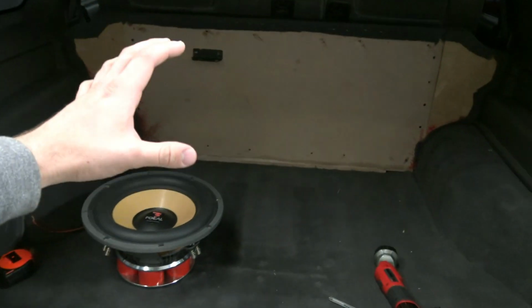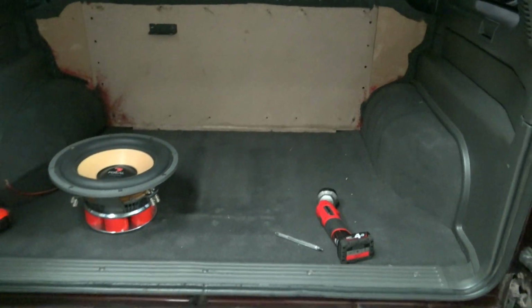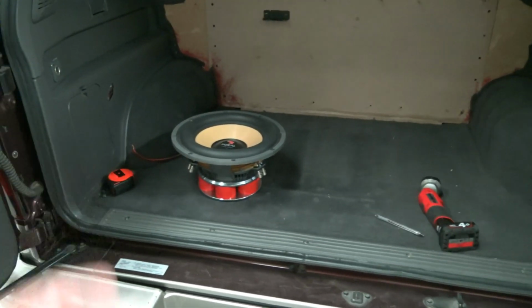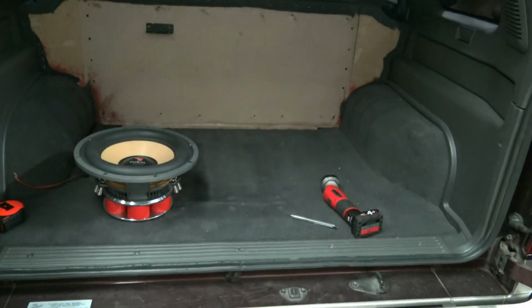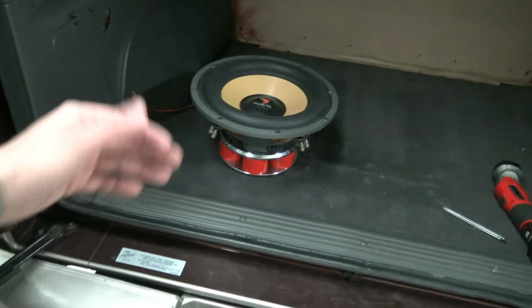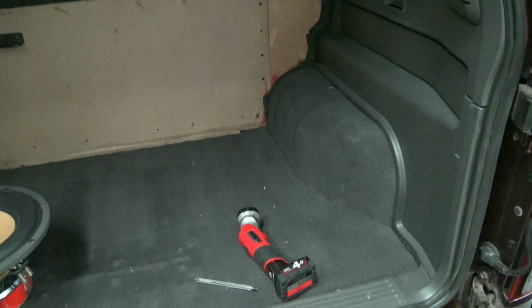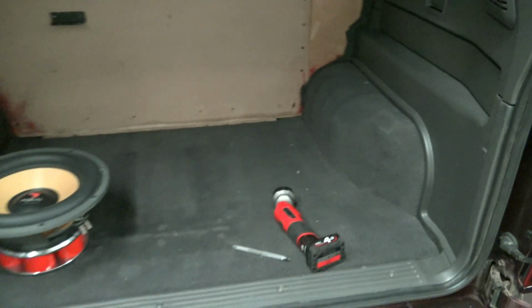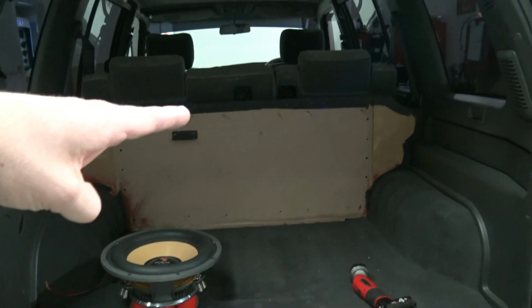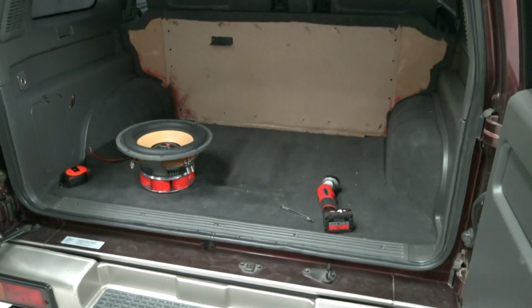the car. Alright, so we're going with the 613s on top. 1, 2, 3, 4, 5, 6, just like that, nice and straight and easy, because that's the only way I'm going to fit them in. As you can see how big 1 is, you can imagine 6 will only just fit. Depth wise, we're going completely from that back all the way to the edge here. Full width between the two wheel arch bulbs. And then height, we're doing the exact same height of the amp rack, which is just there. So we're still tuning the same at 30 Hertz.